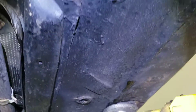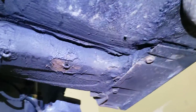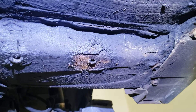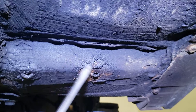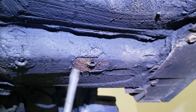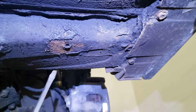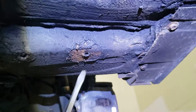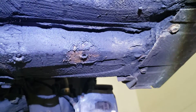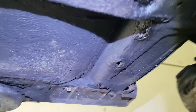That's probably why it has not rusted. It all looks good, and if you look here for example you can see that a piece of undercoat has flaked off, but look how solid this is. Whatever rust you see here is just very surface rust. Nothing is rusted through — all this looks original and it's uniform with the driver's side.